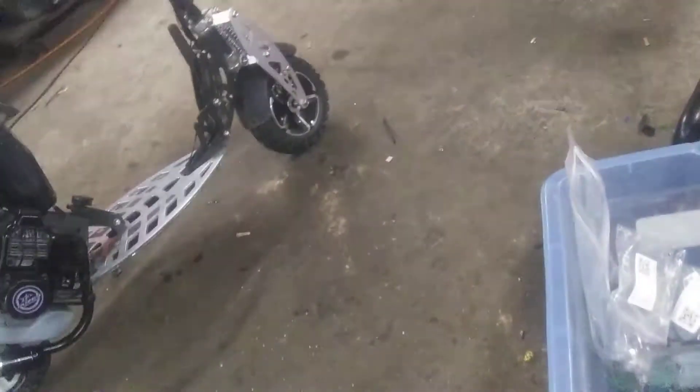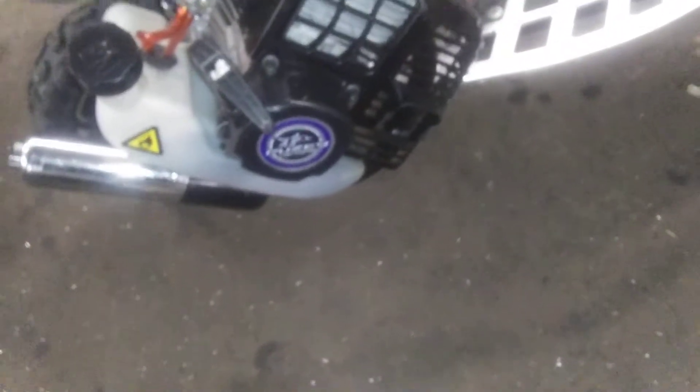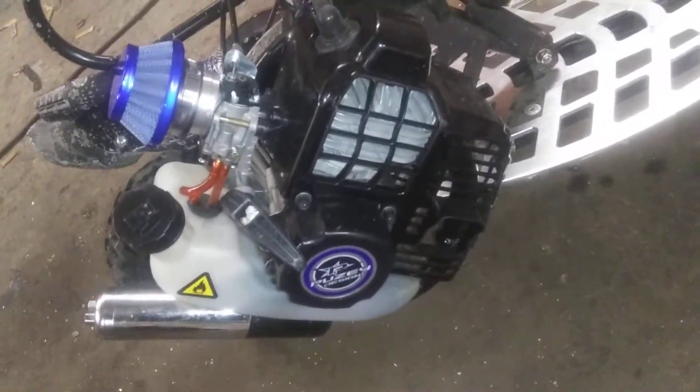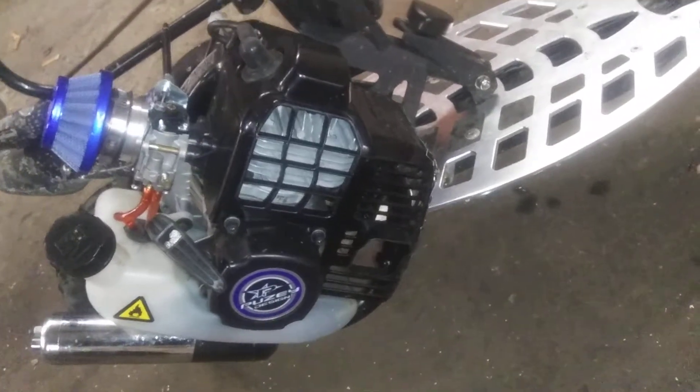What I did for this exhaust gasket is you get a ton of extra gasket material — heat shielding, whatever they call it — from the factory. I just made another gasket out of the extra material that was on it, because you don't need that once you have an aftermarket muffler on it. For the bicycle exhaust, all I really had to do was, since I have a welder, make a flange for the engine and put another 45 degree bend in it.